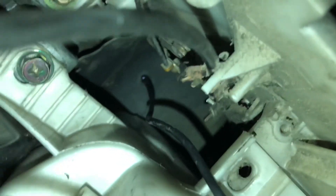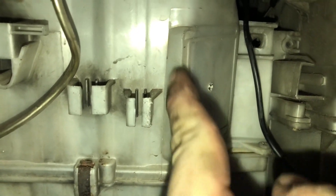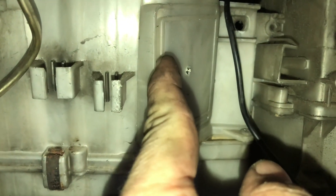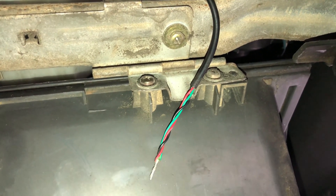We have enough wire coming through the firewall — between the AC or heater box. This line here is the center line from those big aluminum lines that come through the firewall on the inside. That's the center line, so I went up from there and measured over about three inches, and it came out just right. That's where the hole comes through the firewall, and we have just enough wire to comfortably attach them to the wiring harness that goes to the boost gauge.